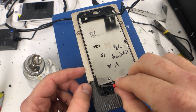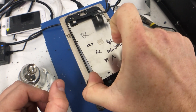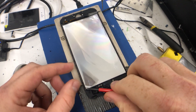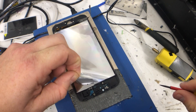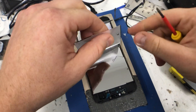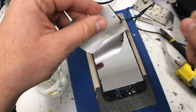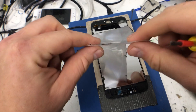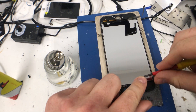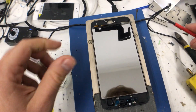Just lift the metal frame up like that, again side to side — wiggle, wiggle and pull towards me. Now we're left with this last little layer here. Watch as I pull this — that black adhesive, it doesn't break and come off in small crap parts. It comes off a lot cleaner in bigger parts. I actually think I prefer doing it with the acetone. Three edges done.